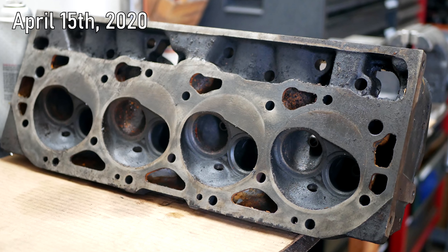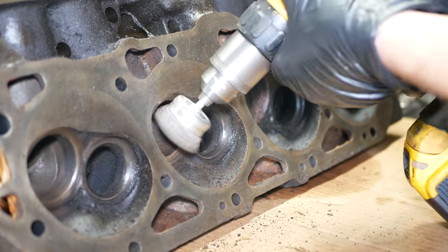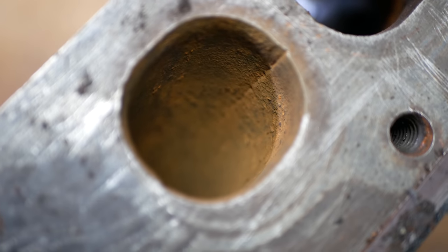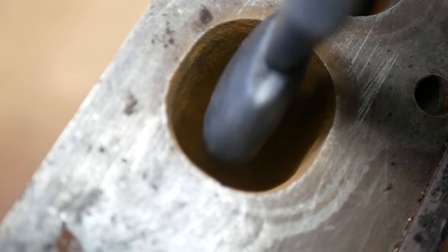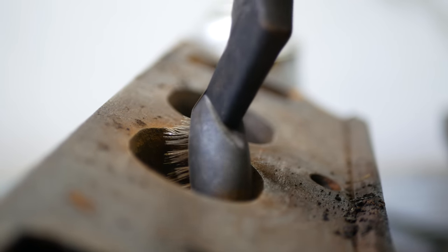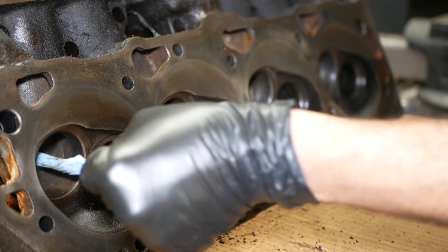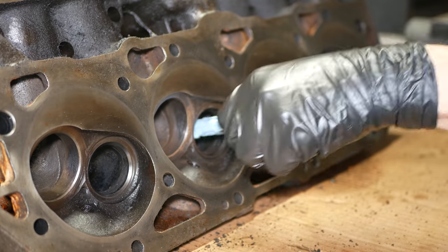After that, we took the passenger side head back over to the workbench, and we'll use this wire cup brush to try to clean out the runners, the valve seats, and the combustion chambers. The heads are looking much better than before, but there are still some crusty areas and I didn't want that to interfere with any of the valve lapping we're about to do. For the rustier intake runners, we'll also try to clean out as much as possible with a regular wire brush. This also would have been a good time to port match the cylinder head to at least the intake manifold gaskets, but I didn't end up taking that step. After that last bit of brushing, we'll spray on more WD-40 and try to clean off any debris that's in the valve area. And after going through each of the chambers with that, we'll run a shop towel through each of the valve guides. This should help make sure that there's no debris in there because we don't need to be grinding anything in that area.